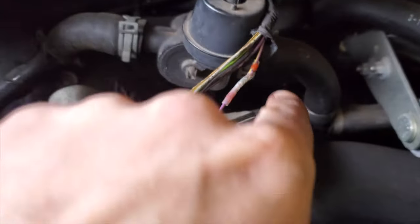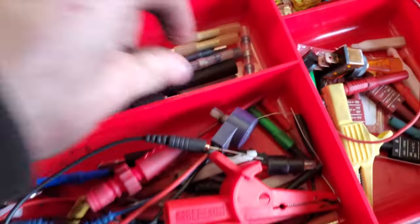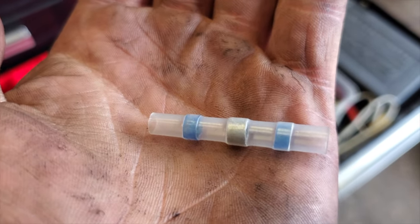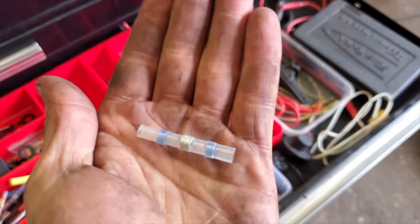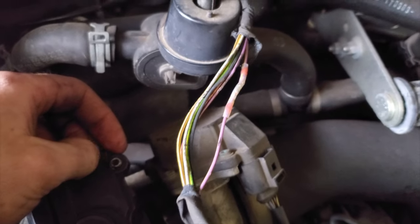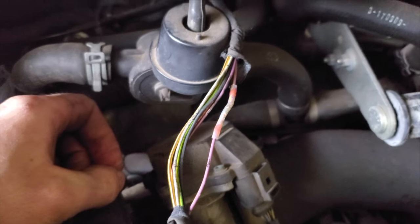What I've done is used one of these solder connectors with solder in the middle of them. You just push both ends of the wire in, twist the wires together, and the low-melt solder core solders them together nice and quick, nice and easy. The coloured bits at the end act as sealant. Because some of the other wires have got slight nicks in them — just punctured insulation, not gone all the way through — I'm going to paint it all up with liquid tape and put it all back together.